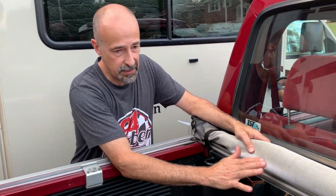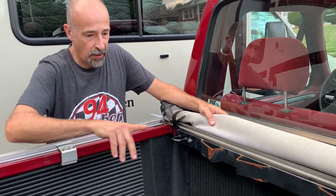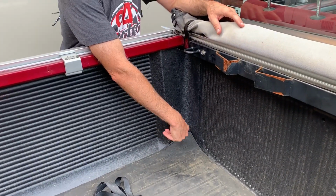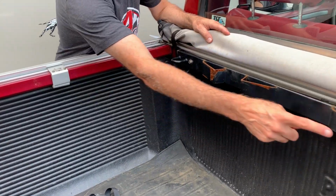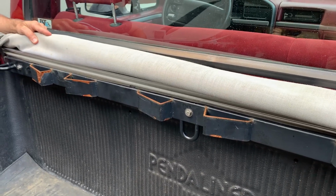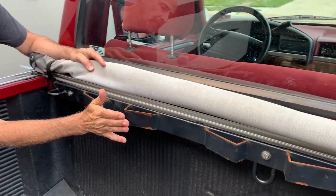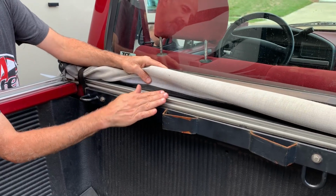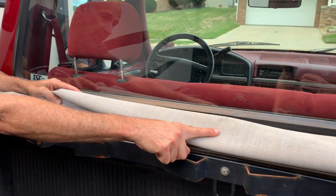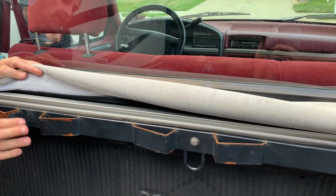But this here is the best product that I've been able to find to anchor the bikes down to the truck. Now, there are brackets on newer trucks that are down low, but the problem is that there's only 2, one on each side. This allows for a center one to clamp the other bike. Now, interestingly enough, we had to mount this bar upside down because of this cover. So originally this bar should be turned the other way and this would be sticking up. So it will give you 3 anchor points. So we had to mount ours upside down because of this cover.